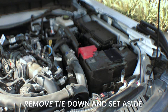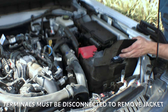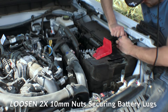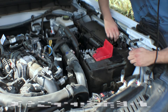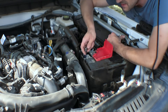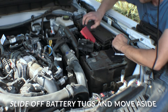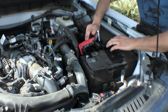Now we can lift off the bracket and set that aside. We're going to disconnect the terminals before we can take off this jacket. We're going to start by disconnecting the negative terminal here — still factory tight, it's a 10mm on the terminal lug. Now with that out of the way, this whole block just lifts off and goes to the side. The little handy-dandy cover will transfer right on over.